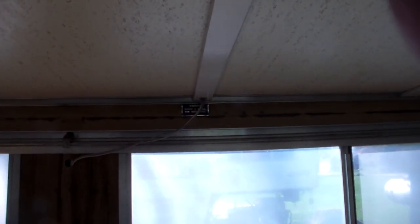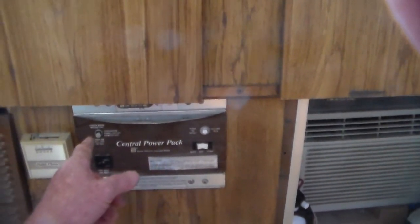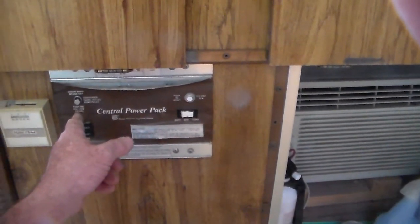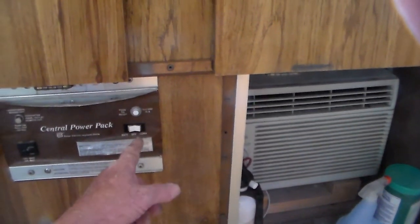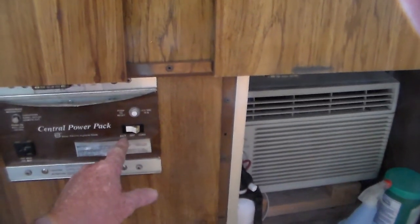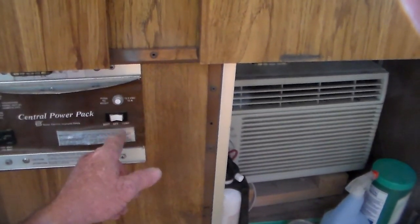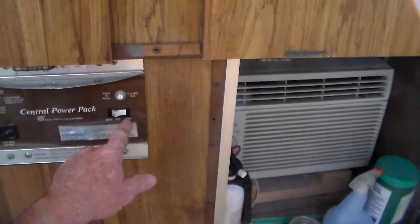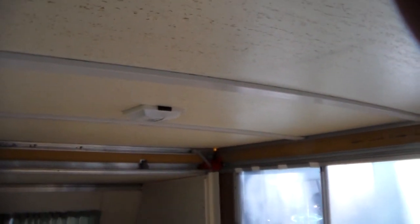Nice big windows. Up here in the roof we have a 12-volt light and a 12-volt fan, with a plug-in on the roof to operate them. Down here on the power unit there's a plug-in and a little safety shutoff for the AC or battery, a reset button, and a switch. Push it this way if you're running off the 12-volt battery; set it to off when transporting; or plug it over this way for converter mode, which converts electricity to 12-volt current so you can run the overhead fan and light without burning out the bulbs.